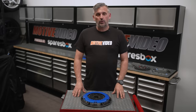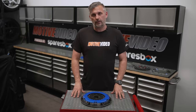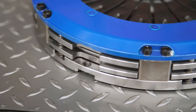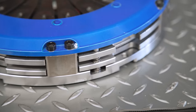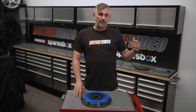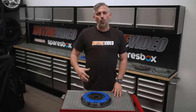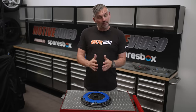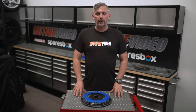Uni-Clutches are made from Australian high-quality billet steel and, like we said, come pre-assembled and pre-aligned ready to go. They are a twin-plate clutch, which basically means they have twice the torque-holding capacity for the same clamping force or pedal pressure. You can go either way with this — you can go for a lighter pedal with basically factory torque capacity but a softer feel, or you can go the other way and have way more clamping force and a heavier pedal, which gives you even more torque-holding capacity. You can set it up however you want, and this holds true for all twin-plate clutches — at least in theory, if not always in practice.